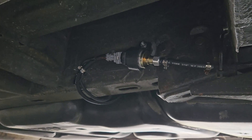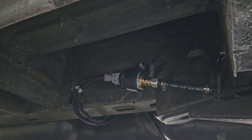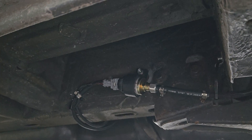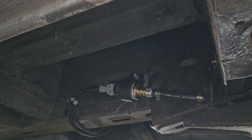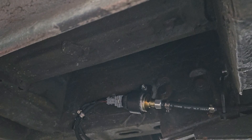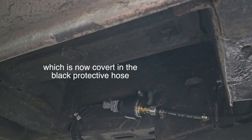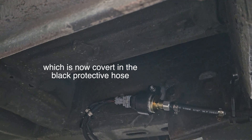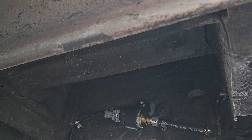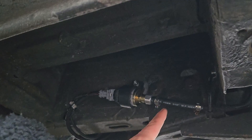It's originally from Conti Tech or something, but I thought I'd save some money. I cut the original hose in half and used shorter pieces, but with the shorter ones the hard polyamide hose just transferred the ticking noise to the chassis of the car, and then the noise was pretty loud inside the van.